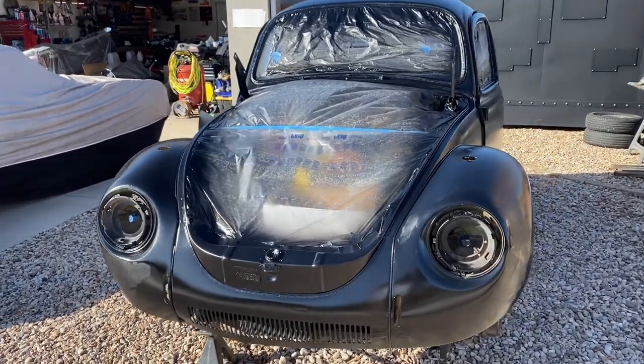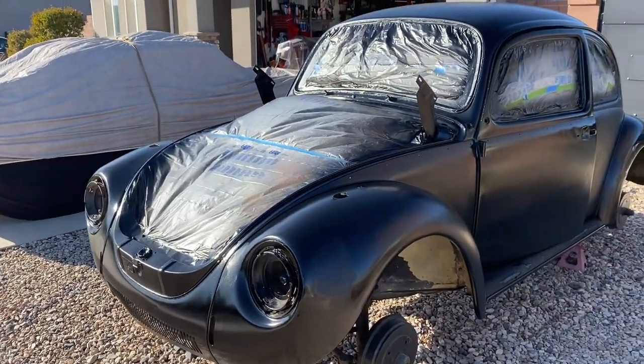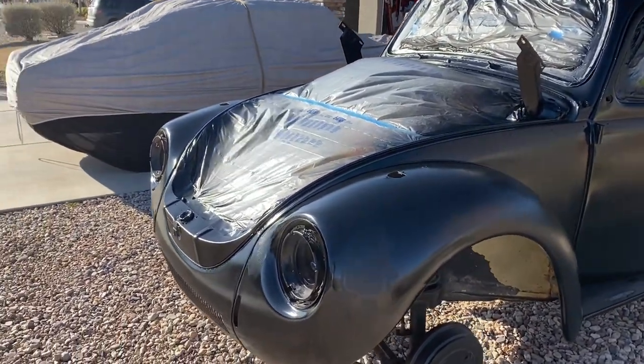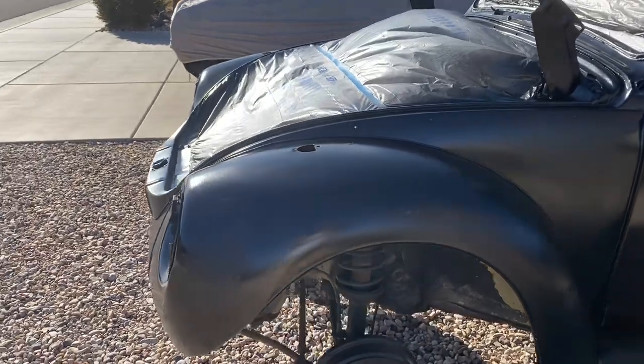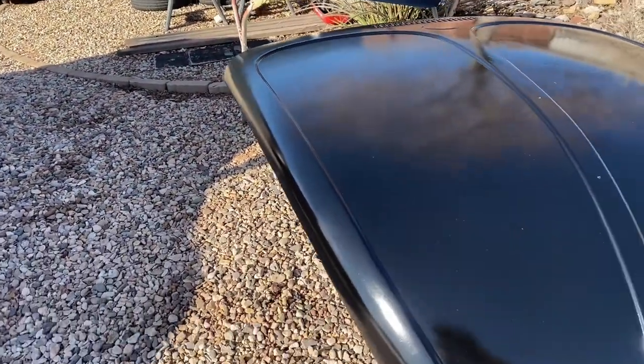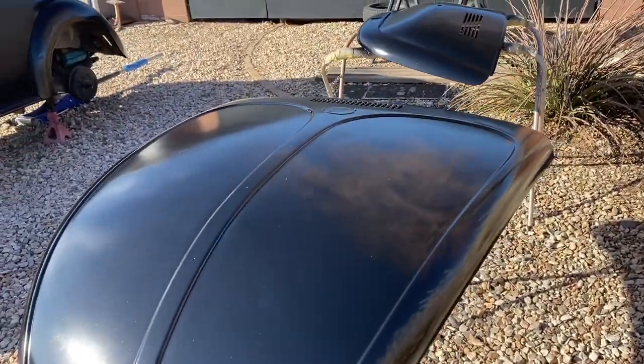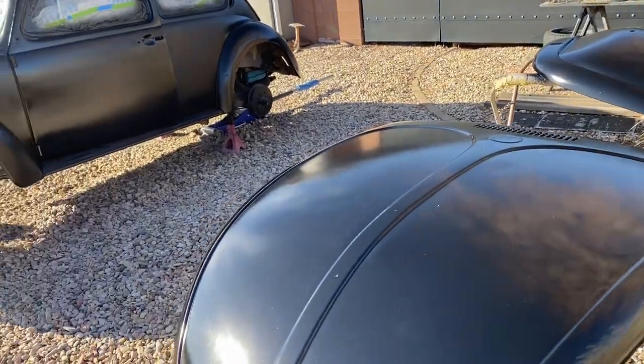Monday, we will paint. After we prep the rest of the surface, probably knock all of this down with 400 to get rid of any texture, any of the orange peeling. And also where we've done Bondo, we're gonna finish those dents up. We're not gonna take it to like show quality, no dent. It's just, it's not that car.